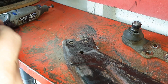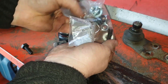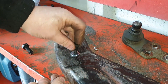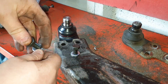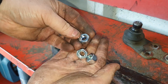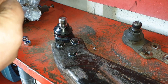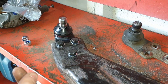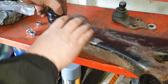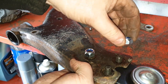I thought they would have designed this with bolts in the first place, to be honest. With the new ball joint it is literally just slide it back into place, line all your holes up, then get all the new bolts and washers out of the kit. One, two, three. Then you put your washers on the bottom. What size are these? I think they're about 17s — yep, 17s. Let me get them all into place and get a wider shot. Just do them up — I'm not going to do them up fully yet.